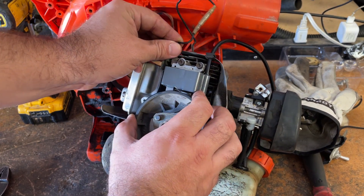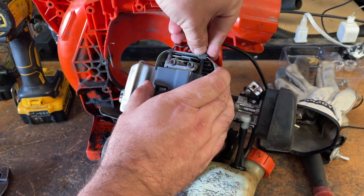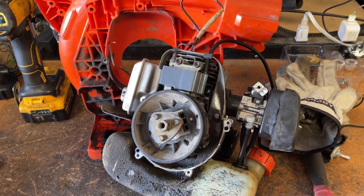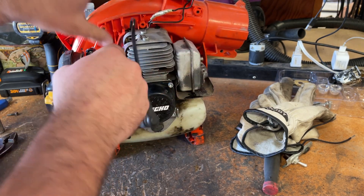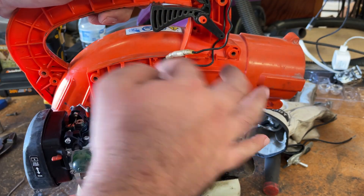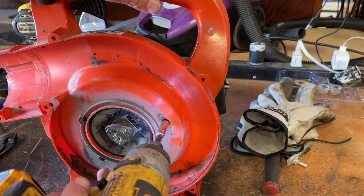Now let's put that electric lead back on. This grommet seems to have fallen off — back on. Grommet on for the spark plug wire. There we go. So there's the old one. Now just to put everything back together. Don't want to forget this little guy. Slide everything back in. You really just have to worry about these wires — just make sure that they don't get pinched. We can re-situate them up there as we need to. Grab the impeller now, we're going to install this.